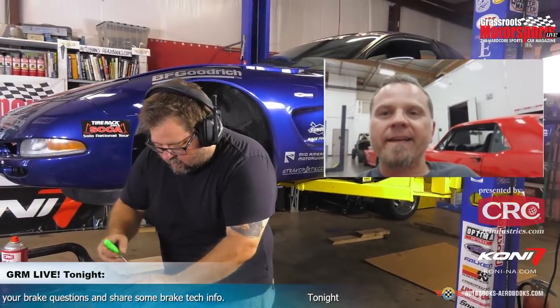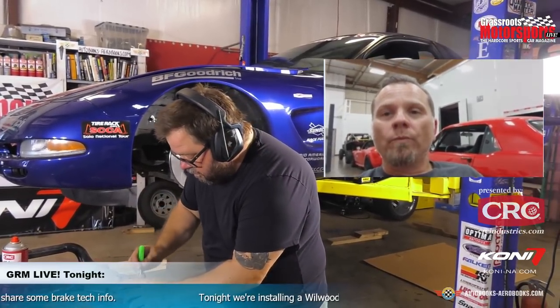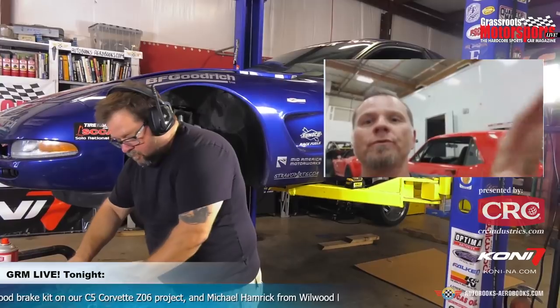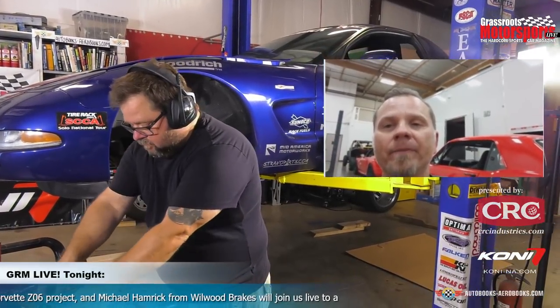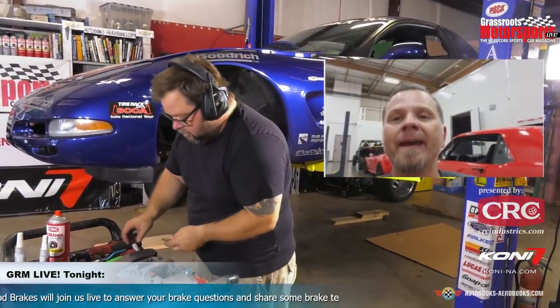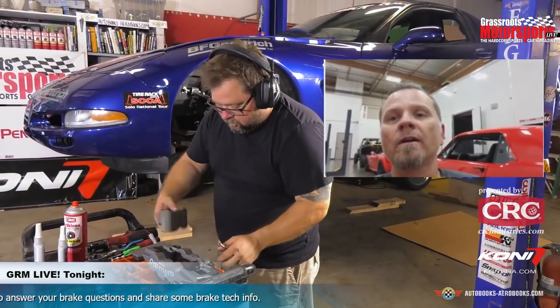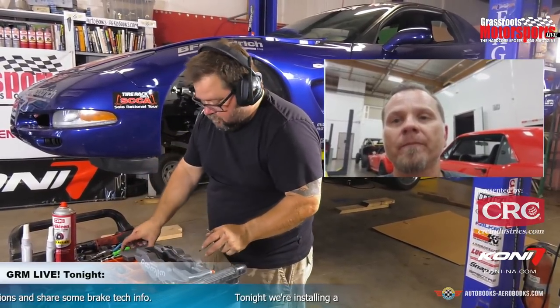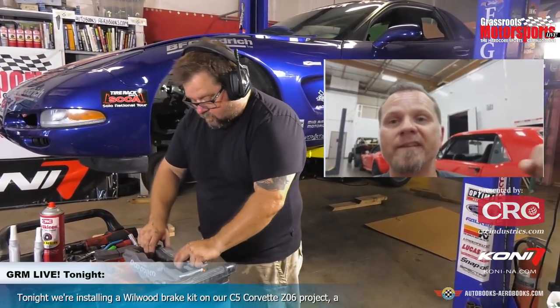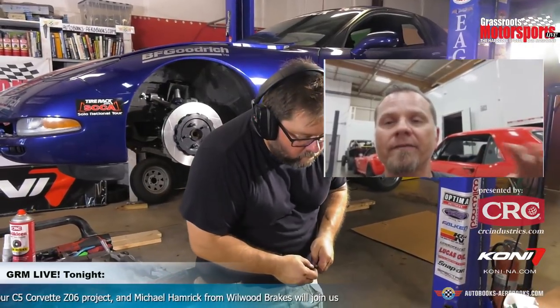So again, in a performance application, especially a car you're going to do track days with or a race car, there are a few reasons for the radial mount type of caliper. One thing that's really nice is you can adjust your radial height to the radius of the rotor. And what happens, and it is reoccurring, and I'm going to bring it up again, is that under temperature the rotor is going to expand. If the brake pad is sitting lower on the annulus of the rotor and it starts to grow, you're not going to be wearing the outer edge of that rotor. So what we'll typically do is explain to a race team to probably shim the caliper 30 to 60 thousandths over the radius of the outside diameter of the rotor.